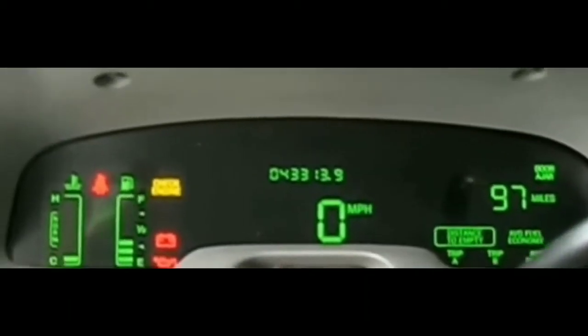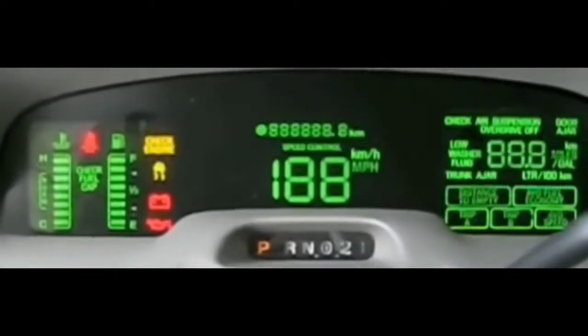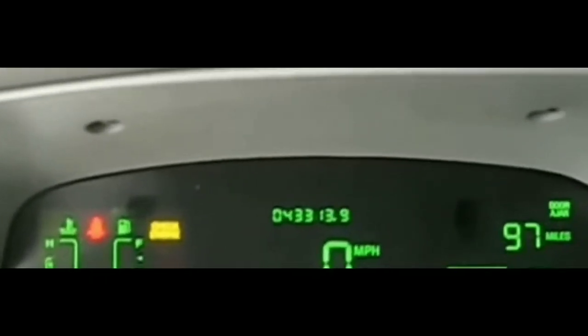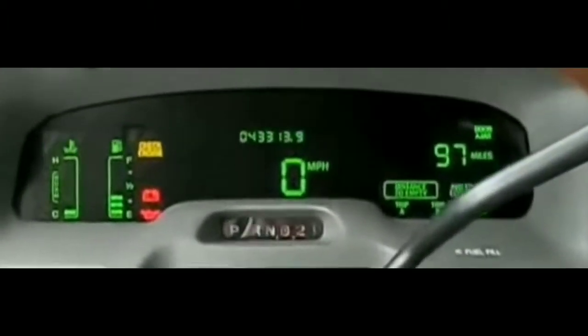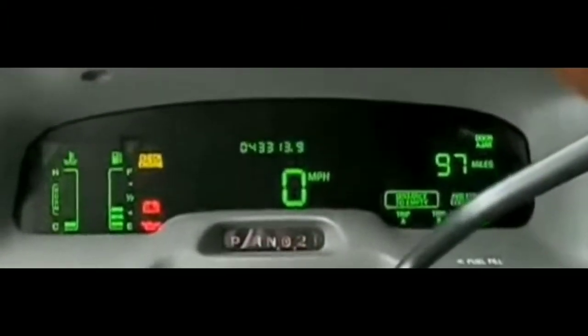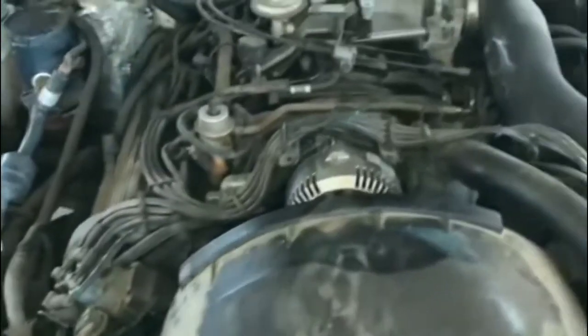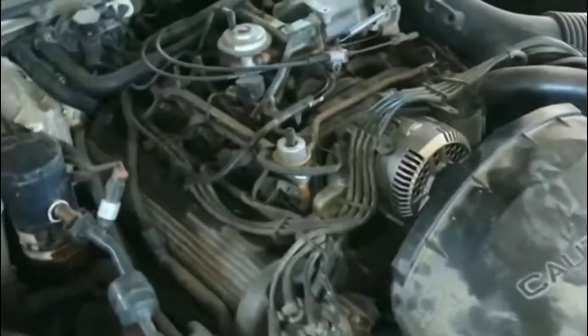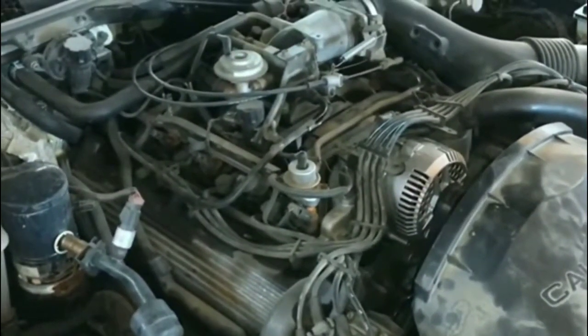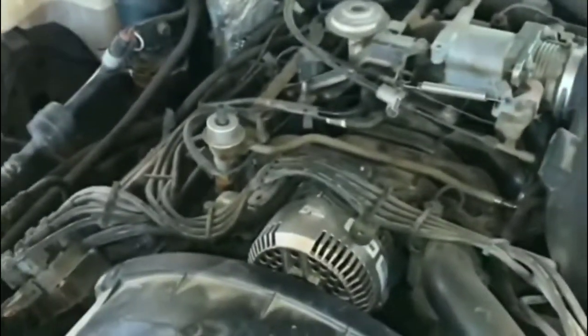So this is probably a bigger issue. Next I need to check the electronics — could be a fuse or a relay. Right off the bat I'm thinking relay. I took the cover off the fuse box and found the starter relay. There was another relay in the fuse box with the same wattage — a similar relay — so I swapped them, hoping that was the issue, because if so I'd just need to Uber to AutoZone. But it didn't work.